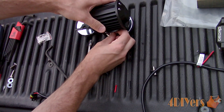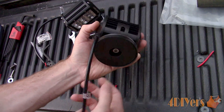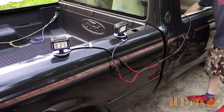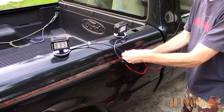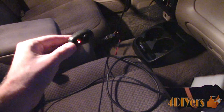For the most part I won't be using this setup on a moving vehicle so they won't experience any vibrations. Once the light and mounts are together, even with the lining on the tailgate the magnets do mildly stick to the metal behind. They mount perfectly on top of the box. We can face each light in opposite directions and even alter the horizontal angle of the beam. The switch wire is long enough I can leave it outside of the vehicle; the lights can even pick up a power source from a trunk area. And now at night — it's quite dark and you can see it's connected to the 12 volt source with the relay only a short distance away. Flipping on the lights, we have an extremely well lit area — perfect for working on your vehicle, camping, farming, going out on the trails, or loading a vehicle.